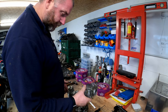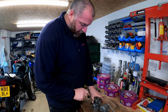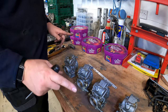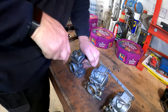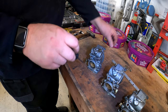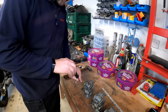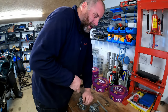Right then, next, float bowls. Okay, we'll start on number four. There's obviously four screws that hold each cap on, but on numbers one and four, there were the little brackets that held the pipe into the end here. So those screws have obviously been removed already. This one looks a little bit mangled. She came out though. Good. Most of the mangling on these screws, I mean, they would have been tight, most of it would have been caused by using the wrong type of screwdriver.